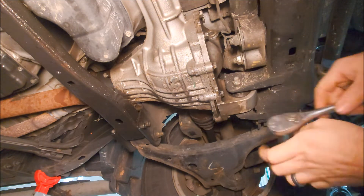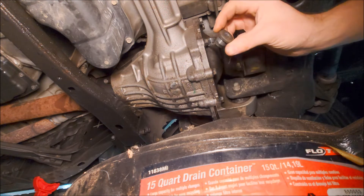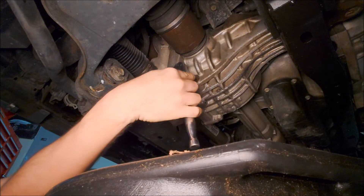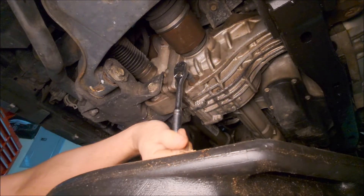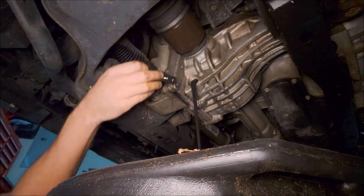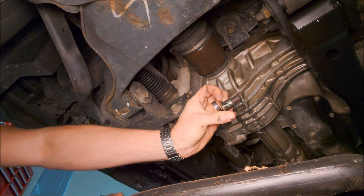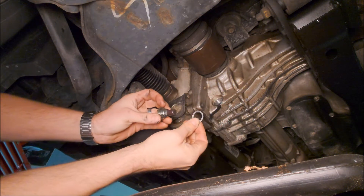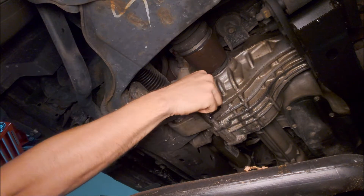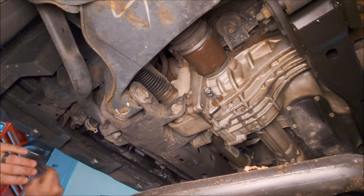We're going to make sure we're able to remove this. That's the plug we're dealing with — same 10mm hex. This is the driver side and this is the drain plug. It's pretty black looking. At this point you're gonna have cleaned your drain plug, got a new washer, or if you want reuse your old washer, put that back in. Go easy on this — your differential case is aluminum. Take your time getting started. Should be about 25 foot-pounds.